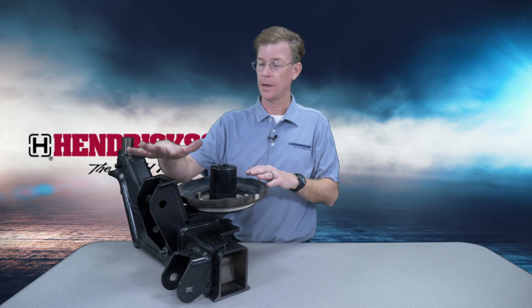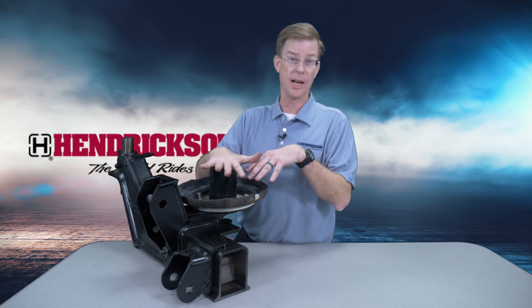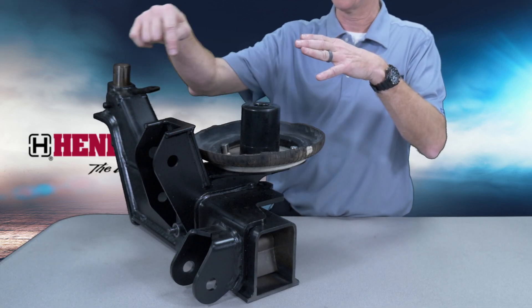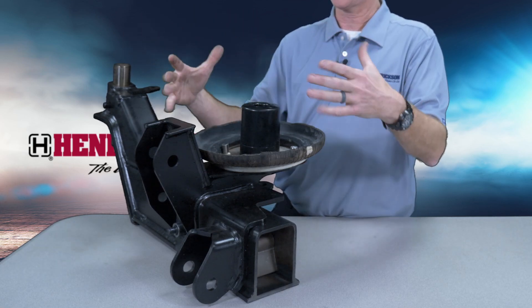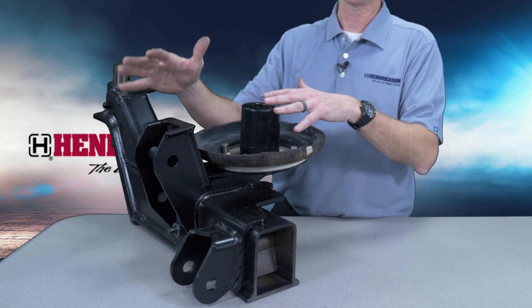So the new product now has a secondary bump stop. When you touch the first stop, if you really high center it and load up or overload the axle, the secondary bump stop comes up in contact with our upper air spring pedestal. It has a tongue so we don't knock your frame. That hits our part and now forms a triangle to carry the load and keep the stress off the other parts.